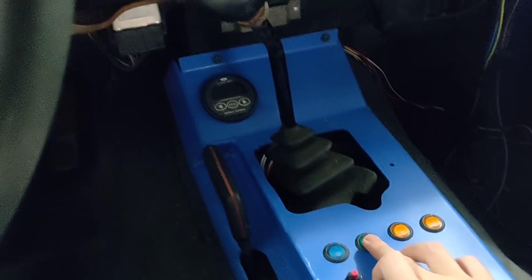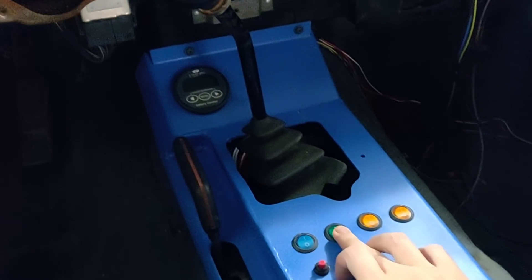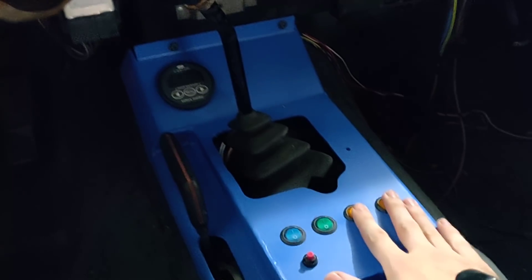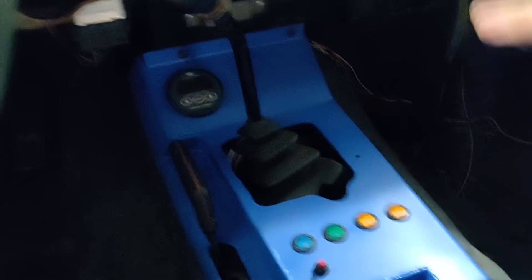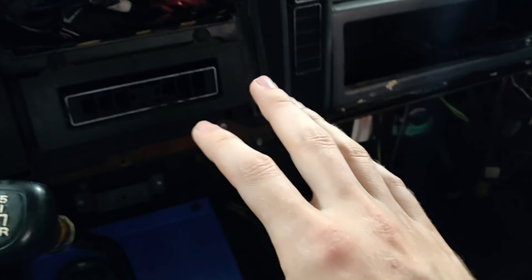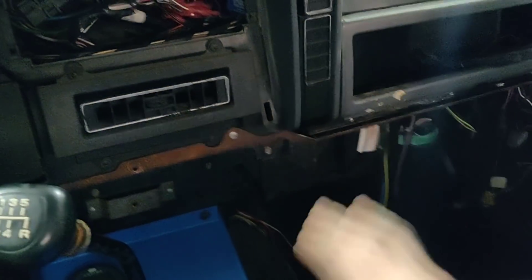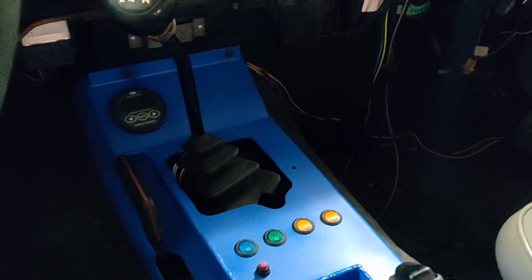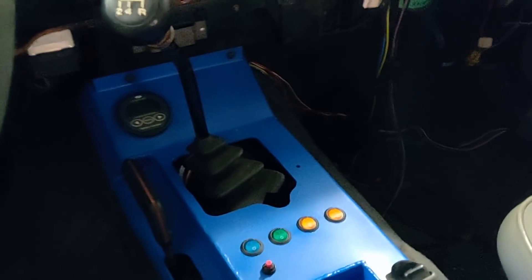This is for flipping on basically an econ mode that uses a little less power and does a little more regenerative braking, and you can configure those settings. These two are for electric heaters to turn on, because we obviously don't have a motor generating a whole ton of heat anymore, so we have to heat with electricity. I've replaced what was normally in the heater core area with two electric heaters that do about three kilowatts of heat, which is quite a bit but also uses a lot of battery. You can turn on one, both, or neither. I'm also going to put in heated seats — I already have the components for that, it's just still August so it's not a priority. That's actually the most efficient way to do heating in an electric vehicle — you need a lot less energy to keep people warm than blowing hot air around.